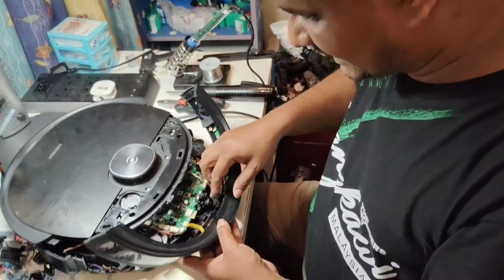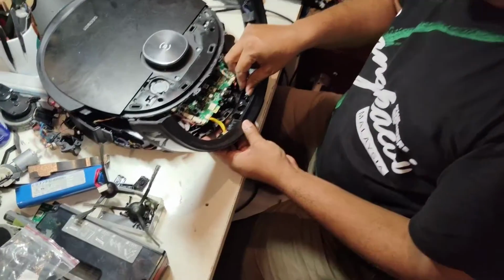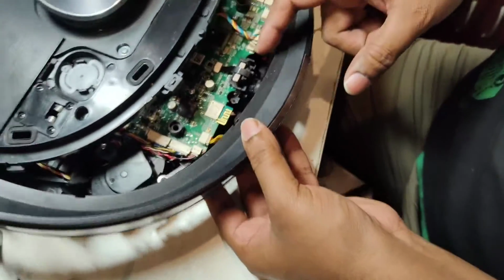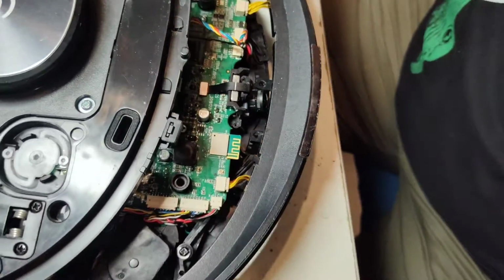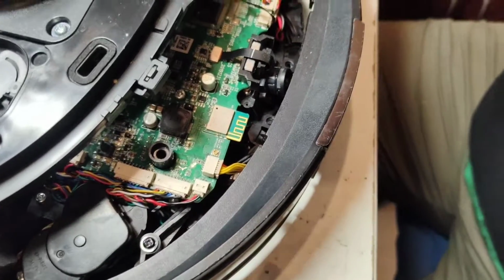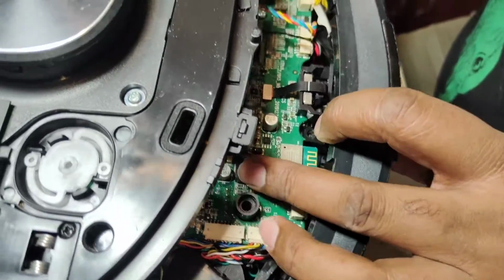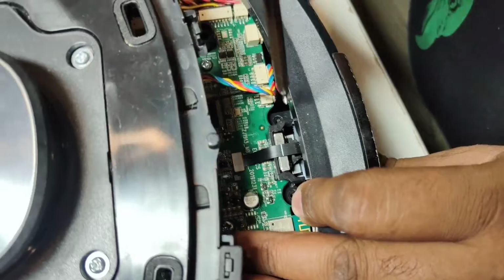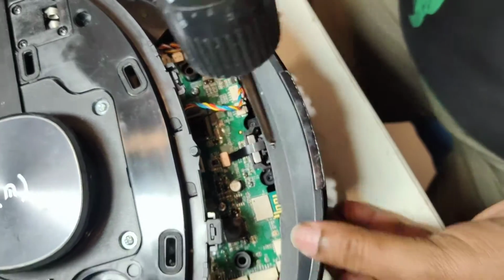Now, you see the camera cover here. Sometimes it's inside like this, so we have to just pull it out. Sometimes it's here like this. Actually if it's here, it's difficult to put back the screw. We just take it out from here like this, and make sure you get your screw ready first. Okay, we need two screws. We get one screw ready here, because it's not just put here nicely. Once you see that the screw place is accurate, just put the screw here. That's all. Now the second one you can easily put back, it won't go anywhere.